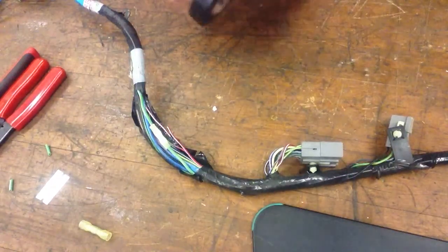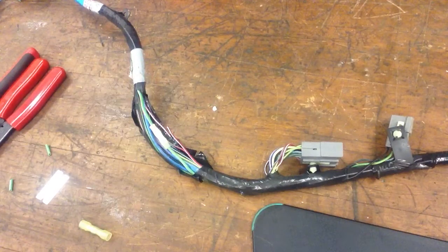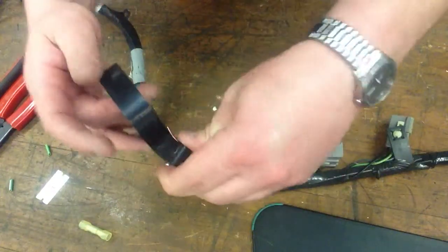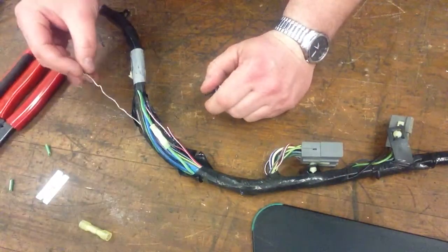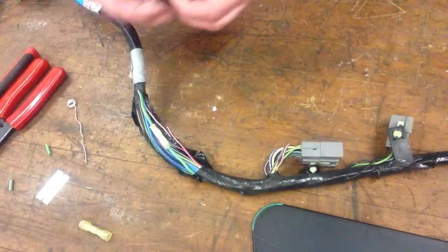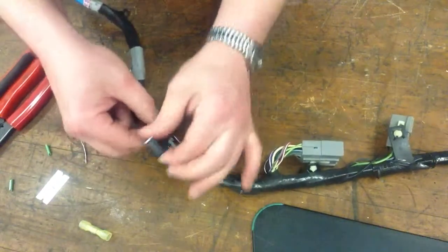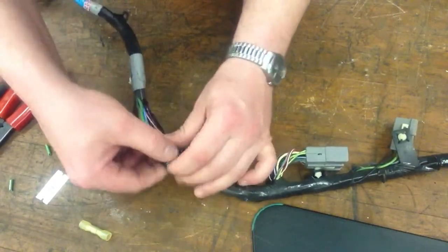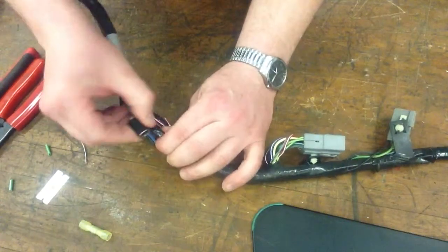As in the other video, I showed you how to make a big roll of tape into a little roll of tape, and I'm going to do that again — putting some tape onto my socket. There is a problem with butt connectors: you can see moisture. If a piece of solder wire can get in there, moisture can get in there too. So we've got to tape them up. They do make a liquid electrical tape, though I've never used it. Bead sealer works really well if you want to go low-tech. Whenever we use crimp connectors, I can't stress enough that you absolutely need to seal that wire up.